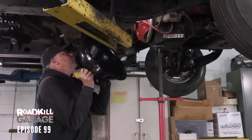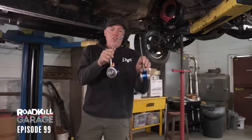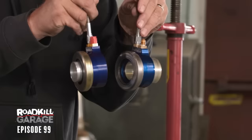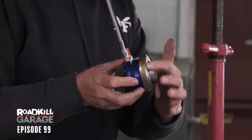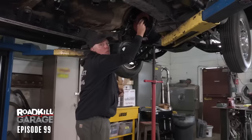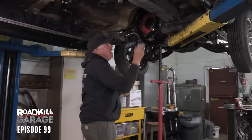The next thing we need to do is throw the bell housing back on, and I'll show you how we're going to take some measurements to set up that hydraulic throwout bearing. Both the old one and the new one are a piece called Hydra-Max from American Powertrain — that's the kit we used to install this six-speed. You can see how the old one is hyperextended versus the new one. The issue is you've got to have a little bit of clearance between the throwout bearing face and the fingers of the clutch — you don't want it riding all the way up against the fingers, or it'll be spinning all the time and wear out quickly. You want about 150 thousandths clearance.